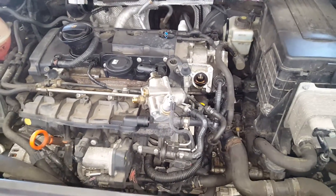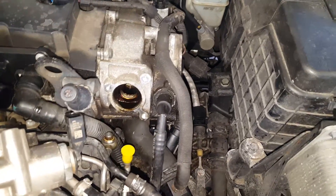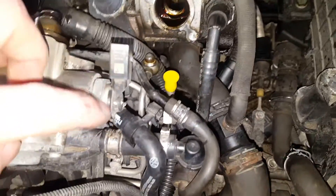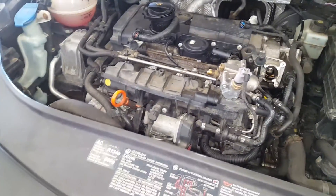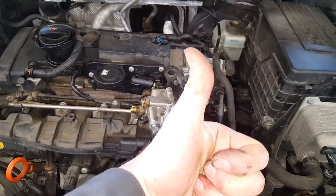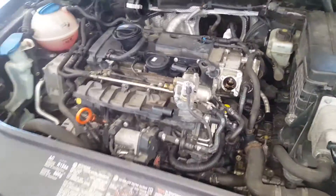If you have these codes there could be other issues. My recommendation is if you have the codes, check this first — I could actually hear this pump was making a little bit of noise. Put a stethoscope right here and listen. It's pretty easy to check this first before going into all the diagnosis and seeing if maybe you have a bad fuel pressure regulator or something else. Anyway, just wanted to give you guys a rundown of what you're looking at if you have these codes. If this is your problem, I feel for you. Give it a thumbs up if it helps you out. KZGuy2, no nonsense, no how.